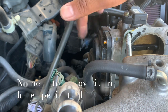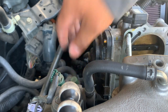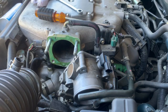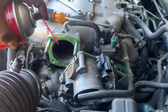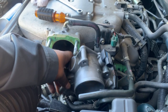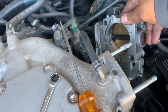Let's go ahead and remove this sensor right here so we can spray it and clean it. I believe it's just two Phillips bolts holding it — one right here and one right here, the other one should be on the bottom. Since we don't want to fully remove it, just clean it all the way around and spray. See, it's nice and clean now. Same thing here — see it's nice and clean. I'll show you the back — see the back one is nice and clean now.